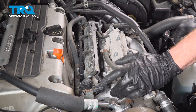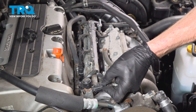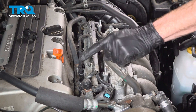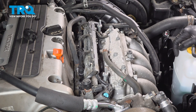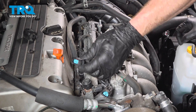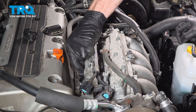Let's continue on to the electrical connectors. For this one, squeeze in on the locking tab along the top and gently pull it out of place. Give it a quick check for corrosion and set it aside. Now we'll start disconnecting each one of the fuel injectors making our way down the line. Each connector has a locking tab on each side — squeeze the two in towards each other and then disconnect it. Quick check for corrosion, and set it aside as you go.